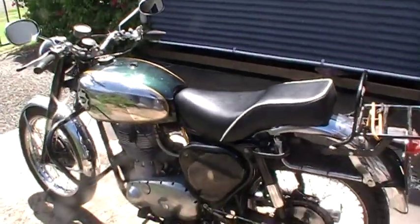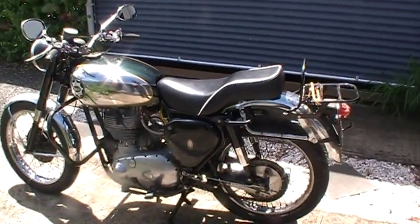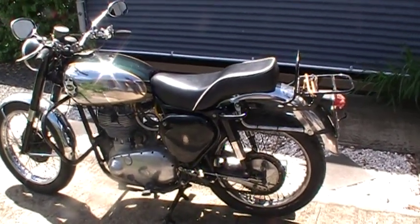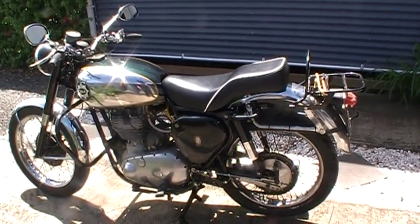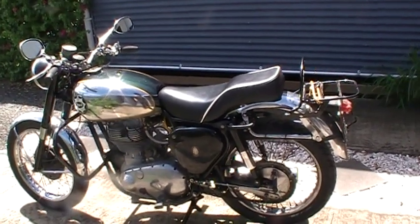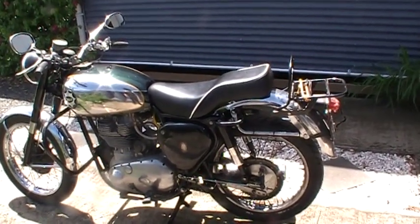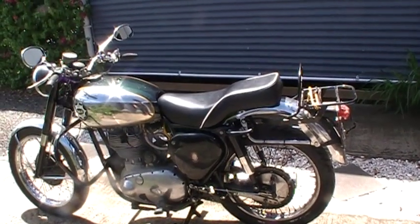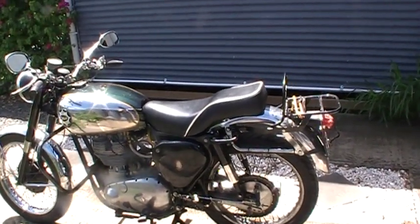The first start was a cold one. I'm happy as a pig in shit to be honest, and it gave me back a motorcycle. Jude has her little AJS Matchless thing — you can see that on this channel. It has a generator-starter motor with a V-belt drive, very much like what you find on the Moto Guzzi singles, the Falcones. That's where I got the idea from — I looked around for a starter-generator and there you go. At about 1000 RPM it drops into generator mode.